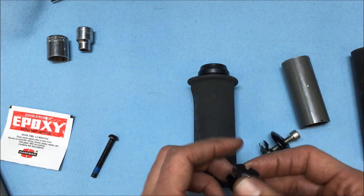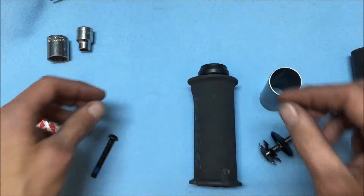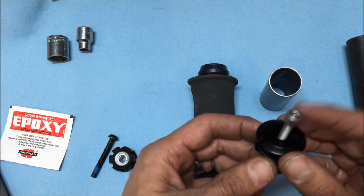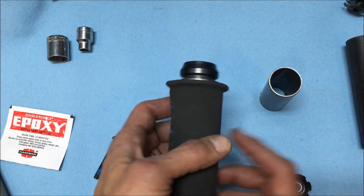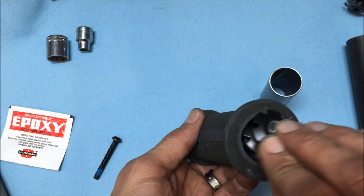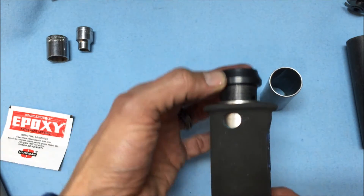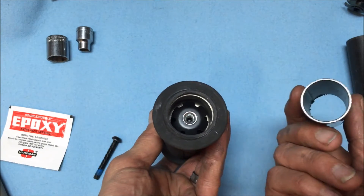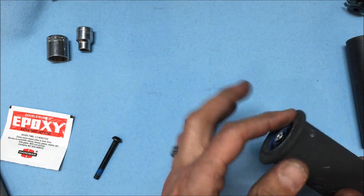For the actual star nut, you're normally going to install it in a steel or aluminum steer tube. I've got a chunk of steel steer tube here as an example. We're going to put in this Chris King star nut — that's the top cap and bolt. This is the tool I normally use to install star nuts of this style. You thread the star nut down onto the little nub, it presets to a certain depth, then stick it over the steer tube and hammer the top until it's all the way in. Unscrew it and you're done — sets it in about a half inch.